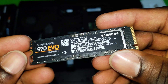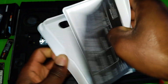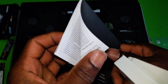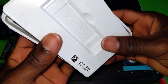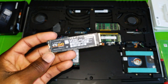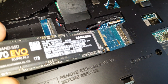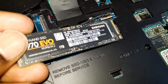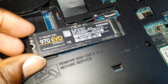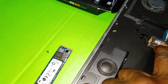Very nice and compact as you can see. Just use the manual for instructions on how to install and precautions — I'd recommend going over it. So we want to go ahead and insert our new drive into the system. If you had a free slot, remove the screw first, and make sure the gap on the SSD matches the slot gap. You basically put it in and wiggle it a little bit, then press it down and put the screw back.